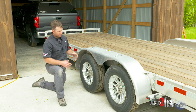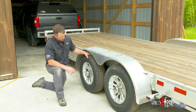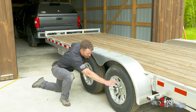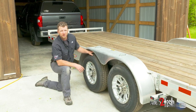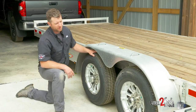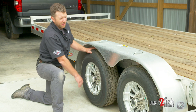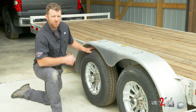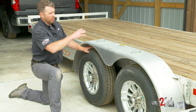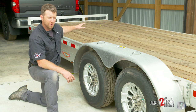We're not going to carry a scale around with us generally, but it's kind of by feel and by sight — if the trailer looks level, it probably is. If your load is not centered, one axle or the other is going to take significant abuse. A 10,000-pound trailer is designed to have 5,000 pounds over each axle. If you don't have it loaded properly, the bearings are going to take a lot of heat, causing stability issues, tire wear, and bearing problems. Loading your trailer properly is as or more important than the right pin height on your adjustable receiver.